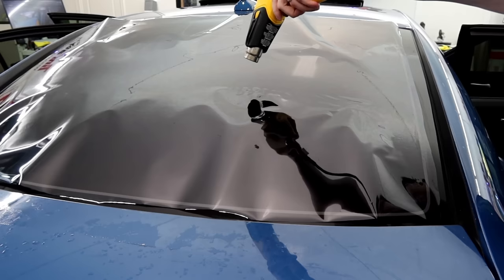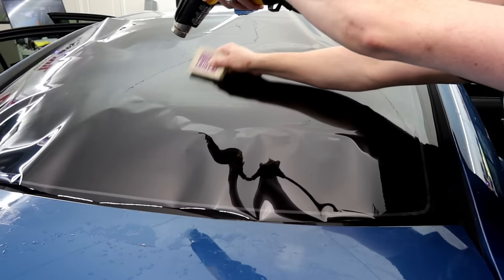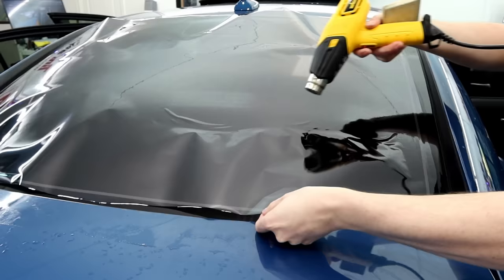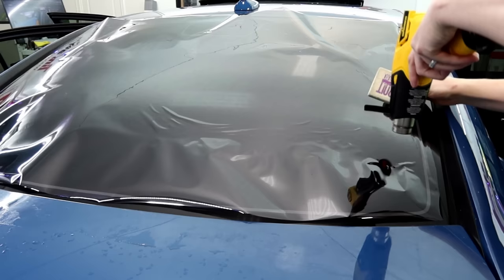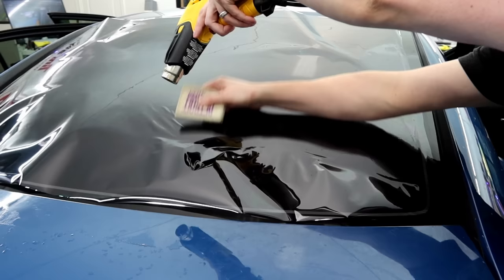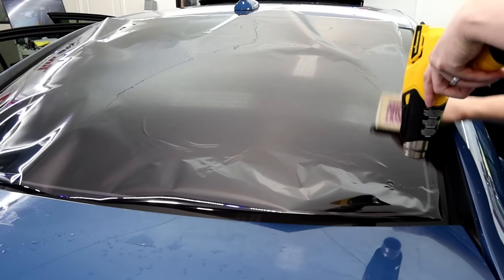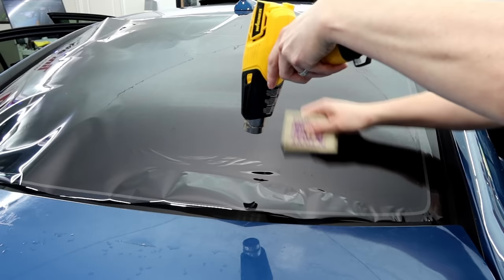This is their HSA Carbon, and this isn't a video to just rag on Lexan. This is a problem I've seen over and over. Somebody asks in my Facebook group, hey, what tint do you think I should start with? What tint is going to save me some money and also be decent quality? And I will see time and time again people recommending films like this — a cheap carbon film, which sounds good, right? You save some money, you get that carbon technology, you're excited, you're ready to go. Well, the problem is you're going to get halfway through shrinking something like this, and then the film is going to require so much more heat and so much more attention to detail. Basically you have to be a lot more aggressive with the heat the farther you go. So if you don't really know how to handle that heat, you're going to cause the same situation we saw earlier — the film starts to crease together.